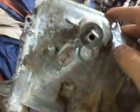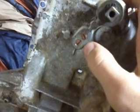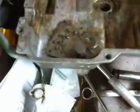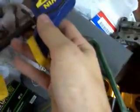If your Transaxle is like mine, where these screws don't want to come out worth anything, and trust me, I tried, that's what this on my finger is from. These suckers didn't want to budge at all. So I'm like, alright, fine, be that way. What I did was take this quick clamp, after, when I had to put it back together. But to get it apart, I took, I think it's an 11 mil box end wrench, and stick it on the end of the shifter shaft.